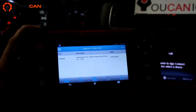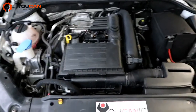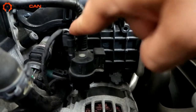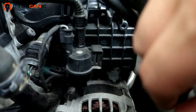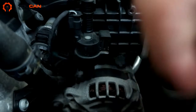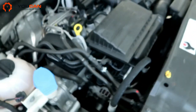Let's go take a look at where that purge valve is located. Here at the front of the engine, if you come over to the side, you can see the purge valve. That's the connector — you want to check that, make sure it's pushed all the way in and that it clicks when you connect it. This could be faulty, but also the connector could be damaged or you could have an issue with the wire harness as well.